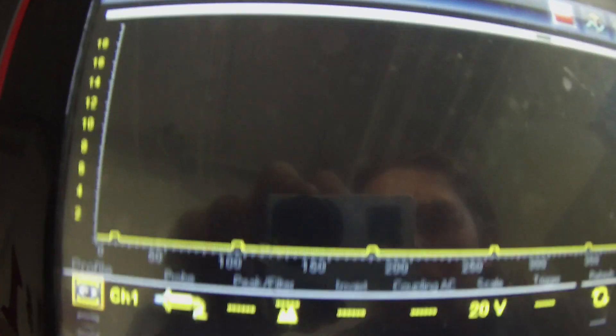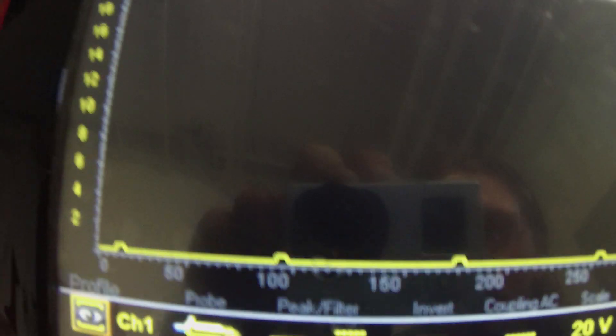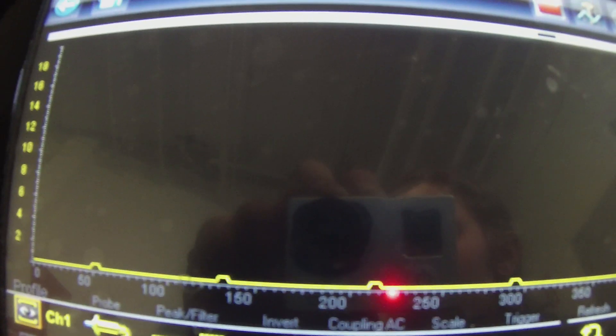Here's our battery positive voltage — going from the sensor positive to battery positive. Now we're hooked up to our signal. It should be a pulsed on-and-off 12-volt signal. We are seeing a little bit of a pulse in there, but that's not what we want to see.